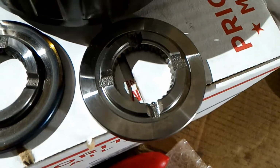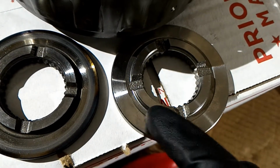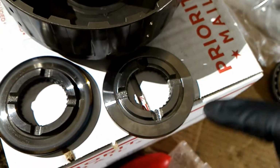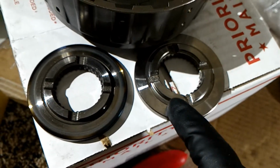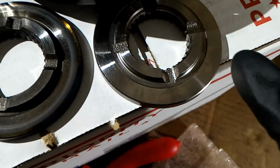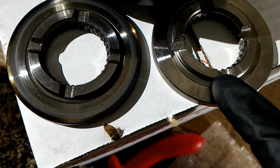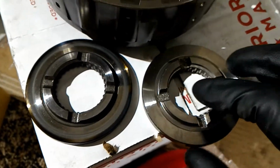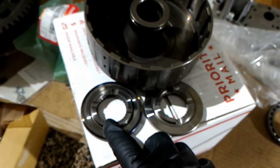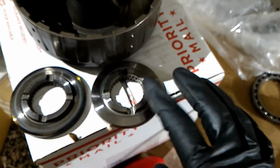Plus, also, this groove right here, I think it's to help retain some of the oil underneath the bearing, because there's a needle bearing that spins around here. So I think that, well, see, here's this groove, and then look at this groove for the old one. It's like 3 times bigger or wider. So I think this is extremely important when you rebuild this. No matter what condition this old one is, this one's pretty messed up. Even if it's not, just replace it with the new updated version.